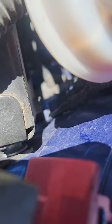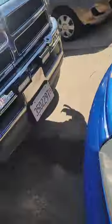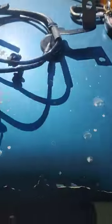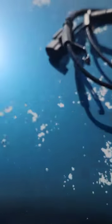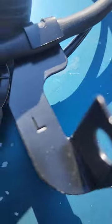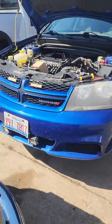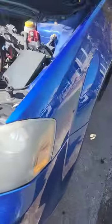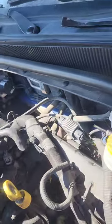This is the clip. Now, the ones that I got are marked, so it's easy to tell which goes on which side. This one has an L on it, and the new one has an L on it — they're both clearly marked L and R for each side of the vehicle. I'd recommend taking the back part of your airbox off: unscrew it, take it off, disconnect the breather tube — it makes everything easier. You're not going to get your hands in there at all otherwise. I even used a pry bar to help.